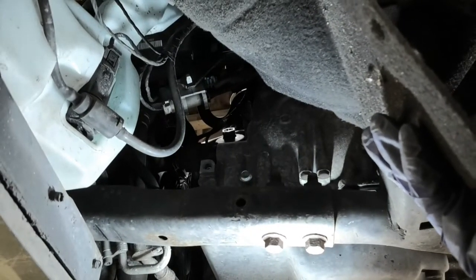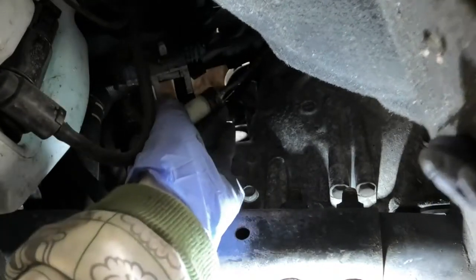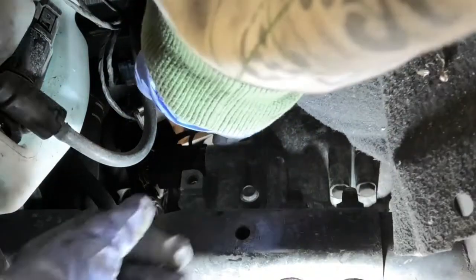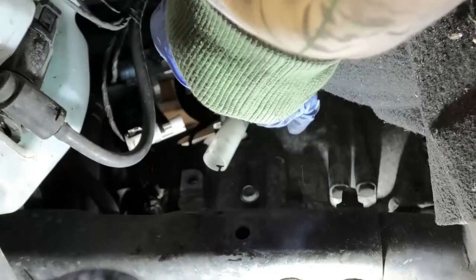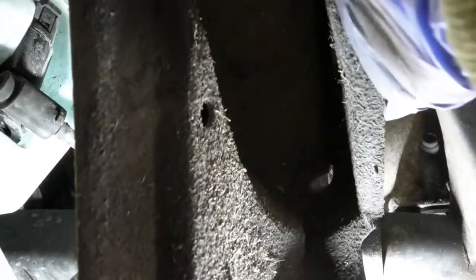That white connector, it's basically the sensor for the pads. So you want to remove it and unplug it. You just need to press on the sides of that little plug and take it out, and then you just need to really follow the cable and remove all the bits where it's held on to. So it's just held on to the other cable that is running down there.